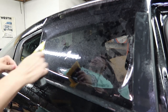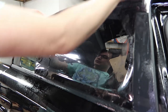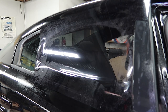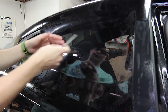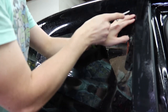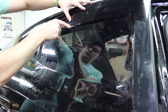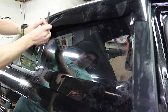We have all our side and bottom cuts. Tack this firmly to the glass because now we need to roll it down — hold up the bottom edge and roll down my window just a little bit to expose that top edge and give you a comfortable cutting spot. You could shift down a little bit more. Now we're using our 30-degree blade. We're going to start on this side, poke it up here, and just try to keep the same angle all the way across. You can shift your body along to try and keep your hands steady.